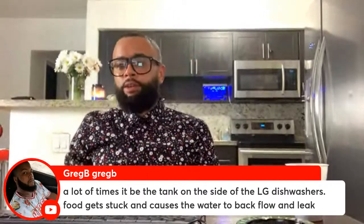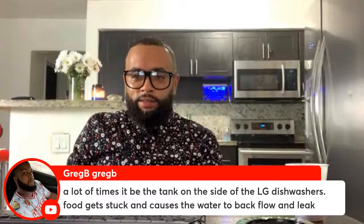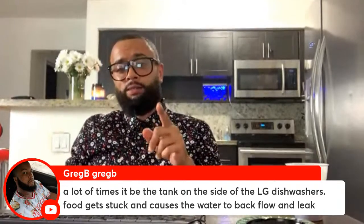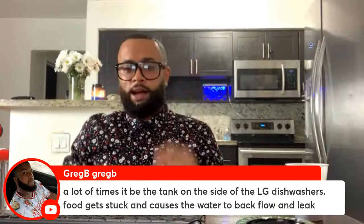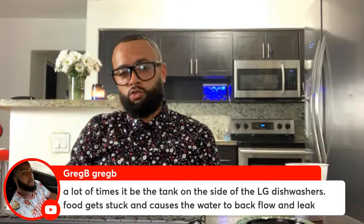All right, what's good, Greg B? It's my guy. A lot of times it be the tank on the side of the LG dishwasher. Food gets stuck and causes the water to backflow and leak. You know who has that problem too? The Samsungs. The case break assembly, the joint on the side with the little flow meter. I see those with LG too.